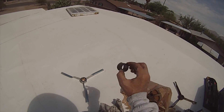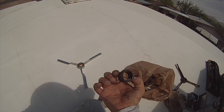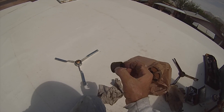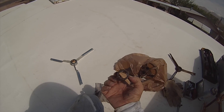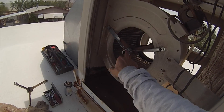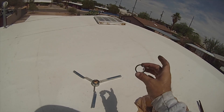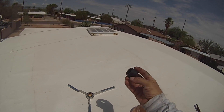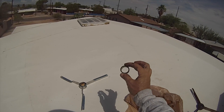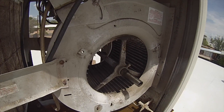I just want to mention this piece right here — it goes over that shaft. Look how dirty that is. Of course it goes without saying that you've got to clean everything. I'm trying to keep everything as clean as I possibly can. This cooler is at least 10 years old and has never had these bearings replaced, so it's understandable that it's this dirty. I did clean that shaft off where the bearing slid over — it had some little pieces of dirt in it. I put some WD-40 on it, sprayed a little on it and cleaned it off with a rag — almost like a brand new piece. That shaft right there had a little bit of dirt on it, so I just wiped it right off.